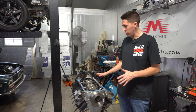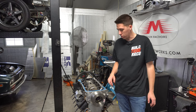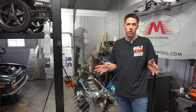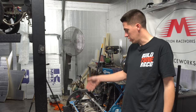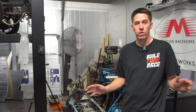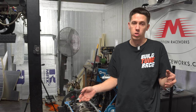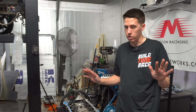So I'm probably just going to leave the engine pretty much like it is. I'll pull the pickup tube, maybe the balancer and front cover and stuff off of it, take it down there and have the machine shop just go over it, the guy that's built these engines before, and see if he'll look at everything and find the simplest way we can get it. Hopefully I can just throw a new piston in that cylinder, swap the reluctor wheel, and put this thing back together. That's what I'm gonna shoot for. That's the most savings of money, and it'll go back in, run it, and then build everything else on the car to more or less plan for when it goes to 6 bolts. So all I gotta do is turn everything up at that point. Hopefully it'll work out pretty decent. Hopefully I'm not too screwed here.